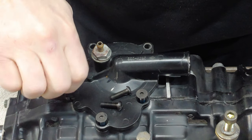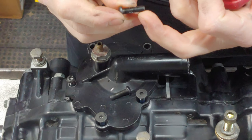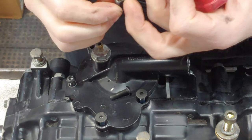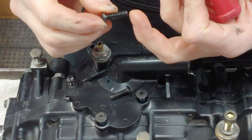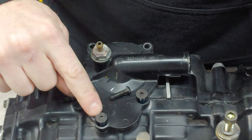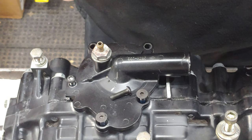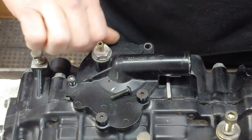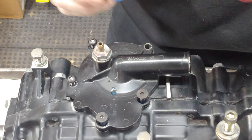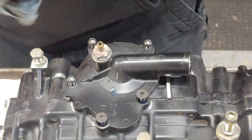And if you guys wanted to order these up yourselves, these are 20 mm. They're M6 by 1.0 threads. And then from the bottom of this flange to the end of the threads is 20 mm. And with these flathead ones, you'll measure from the flat of the head to the end of the threads, and those are 20 mm as well. And these are all black oxide. I know, it doesn't hold up the best. Longevity wise, they're good for low humidity.